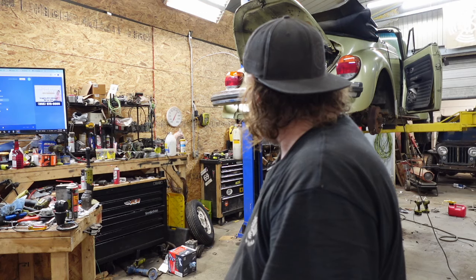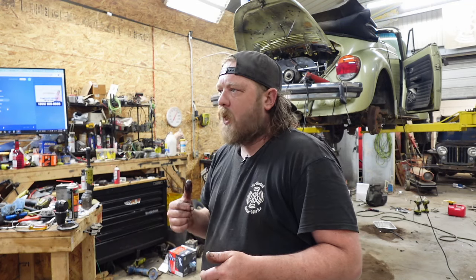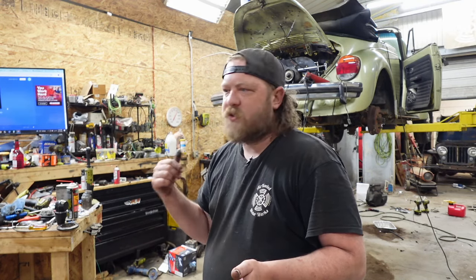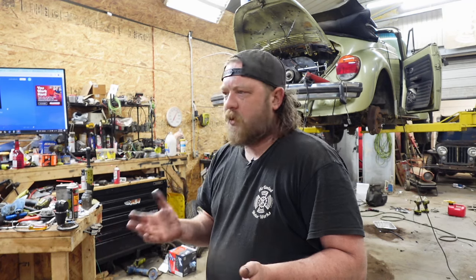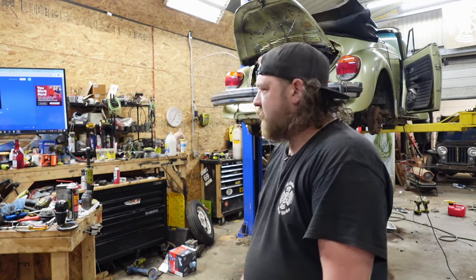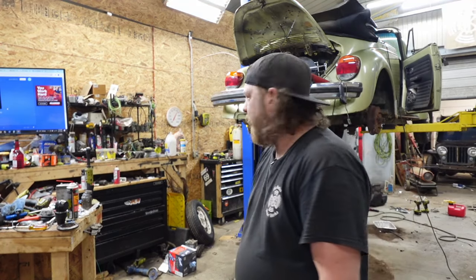So if you set it to just base time at zero, they usually fire up. It kind of did. But I went to my normal thing of 10, and it just was not happy. Backed it all the way down. Usually 32 is the end of the world, give or take, 32, 34 for full advance. This thing's running about 38, 39 full advance. So something's wrong for it not to be happy.